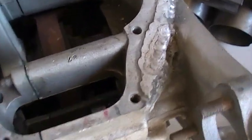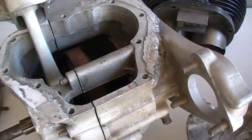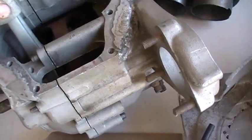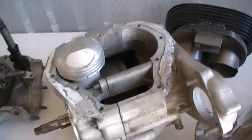I've modified an A65 cam, and well, I didn't, I got a friend of mine who's a better machinist than me to do it. There's still a lot of work, and I'm still trying to figure out what rods are going to work best. The T140 rod there has been just an experimental rod, and it's just been bored out.